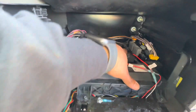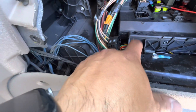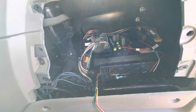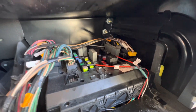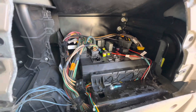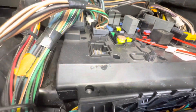To find the right fuses, I put my multimeter's common lead on a ground bolt and checked all the fuses. I went with fuse 12 for the direct constant power — labeled as direct control to the battery. For the ignition-switched wire I used F25, which is the dash splice pack. Not entirely sure what those circuits are for, but they tested correctly — one is always on, the other switches with the ignition.